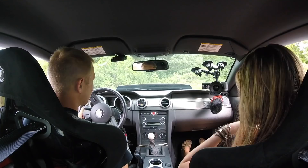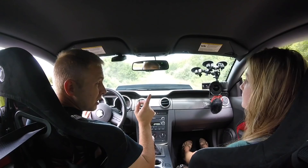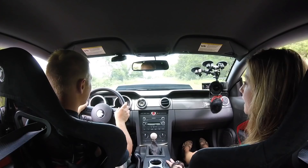Because we just changed the upper control arms. I'm kind of curious how the car is going to act with those. Because before, this thing had no traction whatsoever, and I'm thinking that was a lot of my issue. That old bushing — the bushing over the differential — that thing was so bad. The factory one was cracked and everything. Yeah, it was like dry rotted.